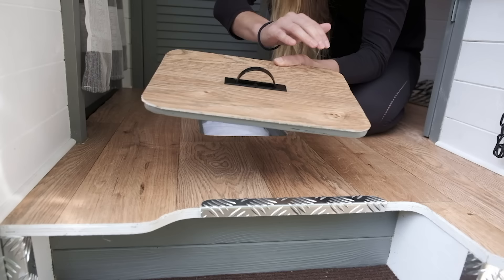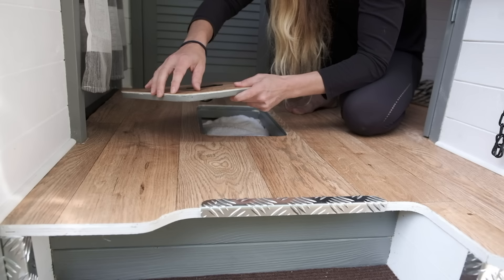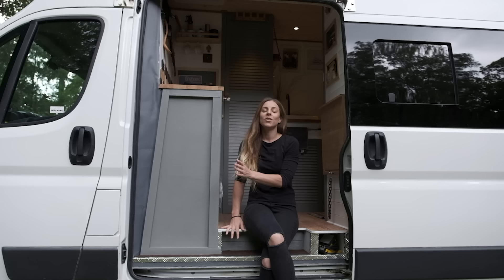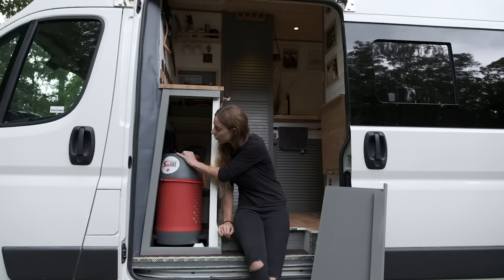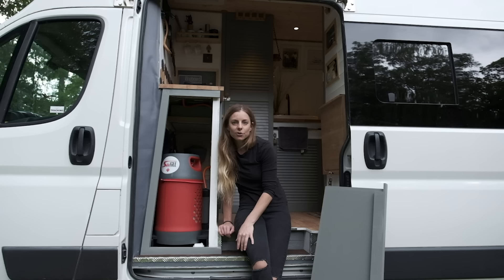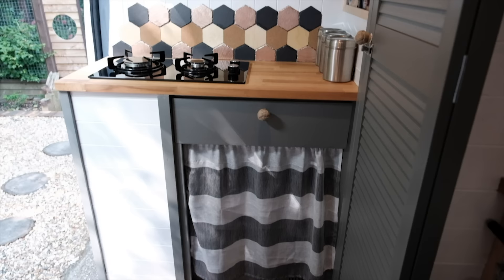I've made a nice little folding mechanism on the hatches that goes flush and looks really clean. It's thick marine ply — hardwood ply — cut to shape with a vinyl fake floor on top. Down here is my other hatch with dried food: canned food, towels, cocoa powder, quinoa, cans of tuna. Over here is my gas locker — a sliding door opening to a full propane bottle, super secure. I've got a 12-volt gas detector and a drop vent as safety precautions. The gas only feeds my cooker and my water heater, and the water heater also has a drop vent on its side in case of a leak.